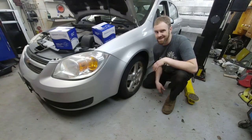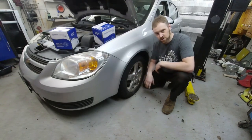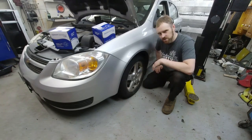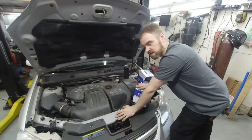The power steering is a bit lacking. I tried turning the wheel and as soon as I got like a turn and a half it got stiff, and going back a little bit, it got stiff again — like it's running out of fluid, maybe a little bit low. It doesn't whine though; normally low fluid will whine.